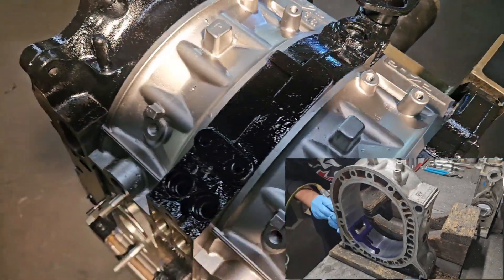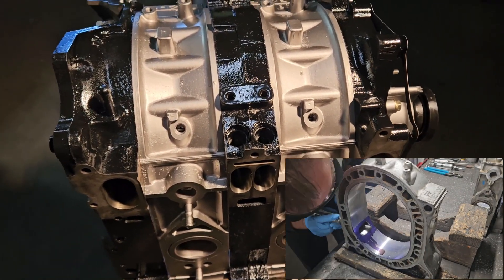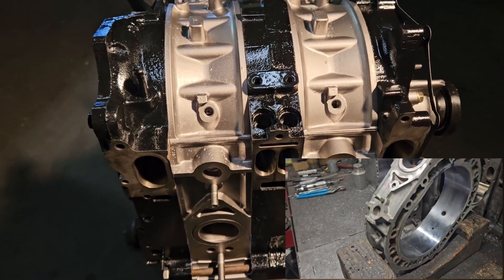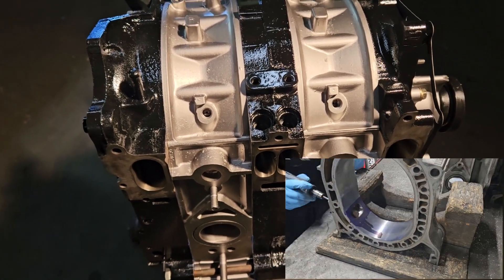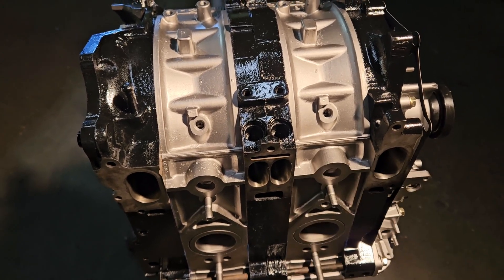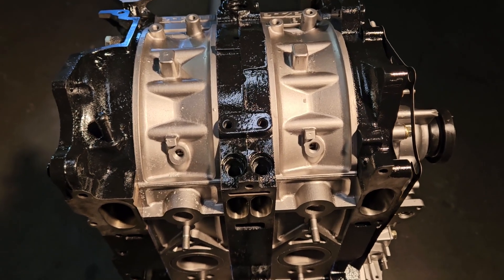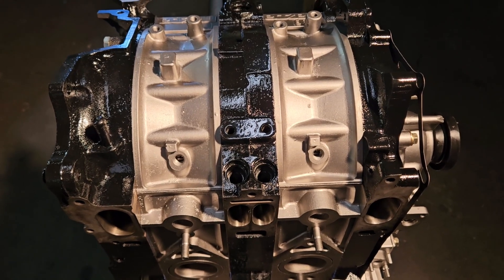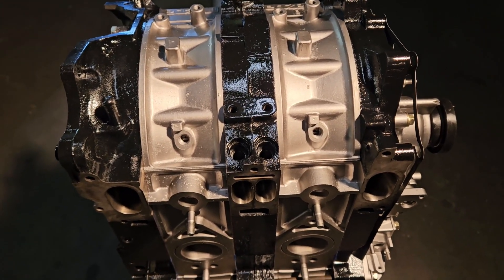This particular build is a full bridge and would probably require a decent-sized turbo and free-flowing exhaust. You don't want to have too much back pressure on a motor that has a lot of overlap. We've seen multiple combinations where too small of a turbo — which seems like a good idea to help with the bottom end — actually ends up affecting the motor's ability to flow. You end up with choked-up EGTs, things get too hot inside due to back pressure, and efficiency simply goes away. Balance is really important with a race motor like this — it's going to need pretty free-flowing exhaust, meaning your turbo can't be too small. With the lightweight rotors, side-cut rotors, and balancing, keeping the RPM around 9,500 to 9,800 is more for reliability. Obviously it could go to 10,000, but if you miss a shift or go slightly high, you could potentially damage the motor. Keeping reliability for the owner-operator and engine in mind is always important.